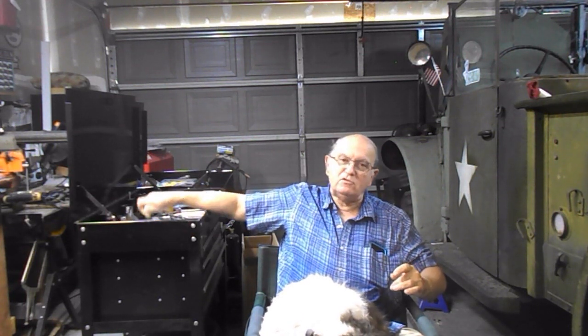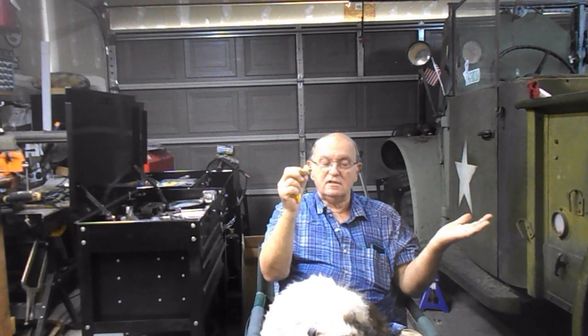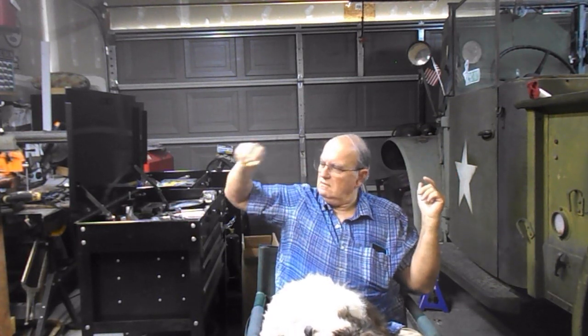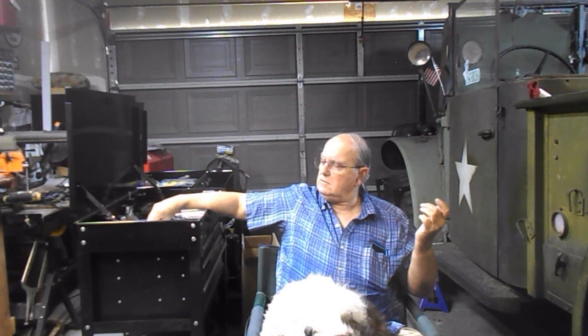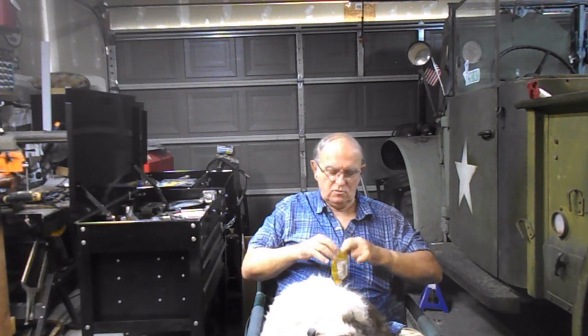And then what you do is you get a valve. It's 1/2 inch outside diameter, 1/4 inch inside diameter. And you screw it in here. Actually, you can buy this stuff on Amazon. It's really cheap. I think the whole thing together with this one and the other valve was like 20 bucks. And you got more than one of them actually. So yeah, so that works. And you go ahead and hook your fuel line up to it and you're all set.